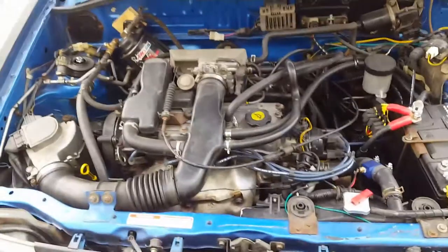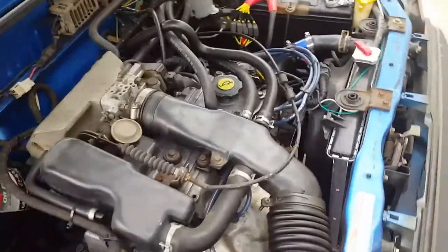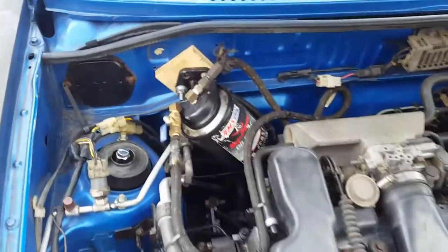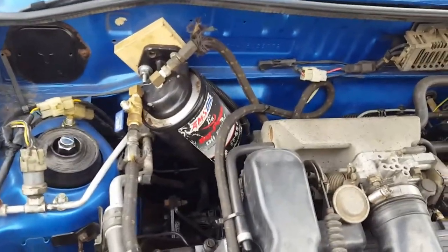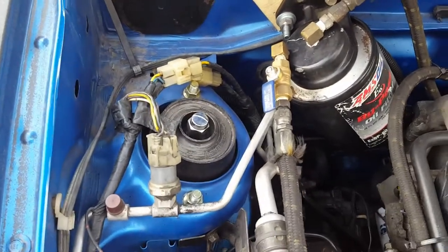I kept the B3 engine. This one seems to have a fair bit more power than my last B3 did. Hopefully it will work for towing. I put a thicker radiator in there — the thin one couldn't keep it cool enough when it was hot out towing. I also added some extra oil capacity, hopefully that helps cool the oil if it needs it. These are the Rio strut mounts with a nut I machined to center the strut.